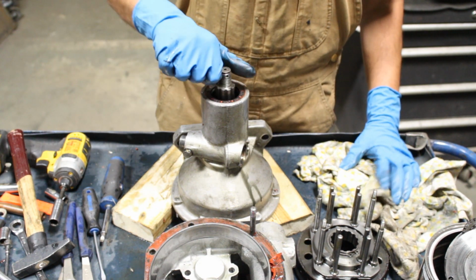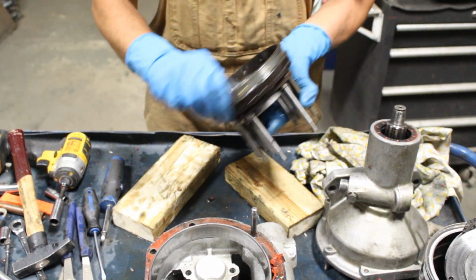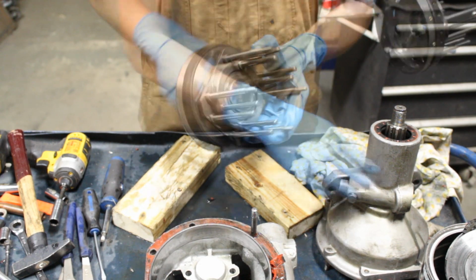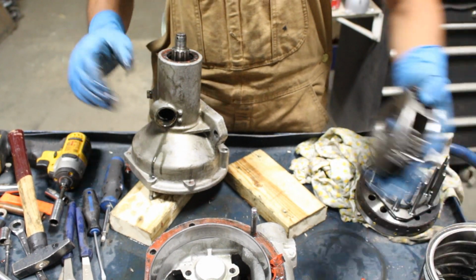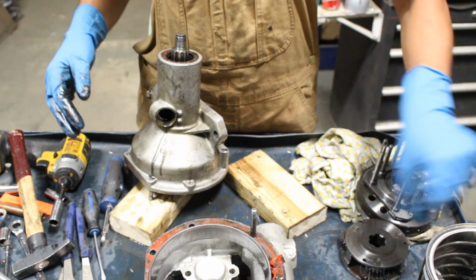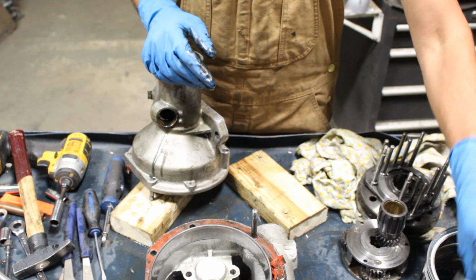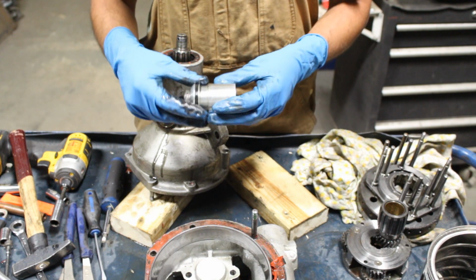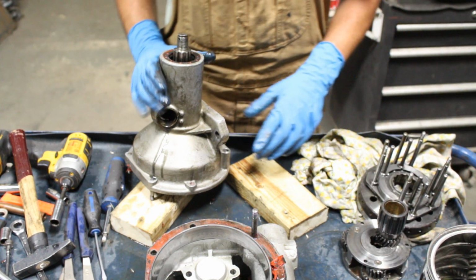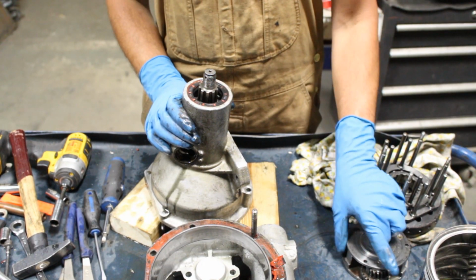Okay, so I think I'm gonna leave everything else as it is, because this bearing sounds great for me. I'm not gonna disassemble the gears from the Planetary Assembly. The sun gear looks good. The pistons look good. Maybe just I'm gonna buy new O-rings for them. And a new bearing for here. And we are done. Wow. I thought it was gonna be much harder.